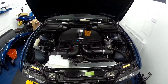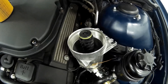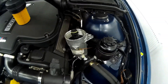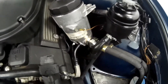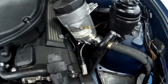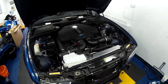The car is now back together: headlights replaced, oil cooler primed, pipework primed. The oil filter housing needs to be primed before putting the filter back in — this only takes around 250ml of oil. Then we can put the filter in, start the car, and check for any leaks. With the engine fired up and running up to temperature, we can check for any leaks around the hose unions. The dowty seals used originally were weeping slightly so these have been replaced with heavy-duty copper washers. There are no leaks on the oil cooler unions and no leaks on the power steering cooling system.